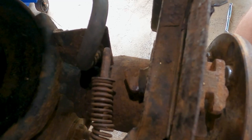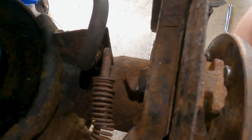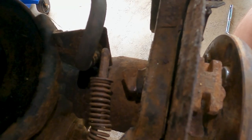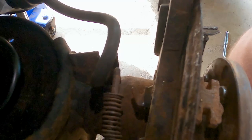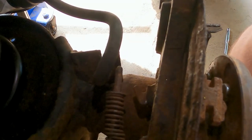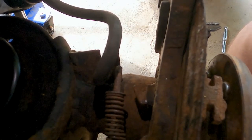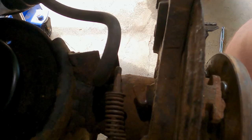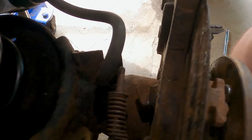As you can see here, my brake cable is actually coming off the lever that pushes the brake shoes out. I realized this after I did my brake shoe replacement video, which was my last video. I could put it on there and pull the brake and it would tighten correctly, but when I would release the parking brake, it would pop off the lever and the lever wouldn't move. The lever is fairly free — I can wiggle it with my hand right now — but let me show you why it's doing this.